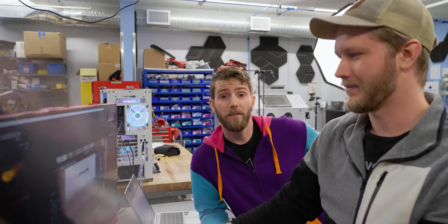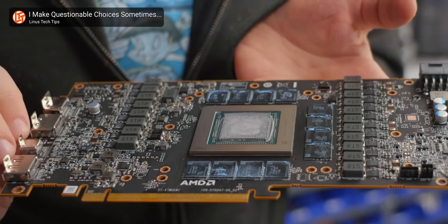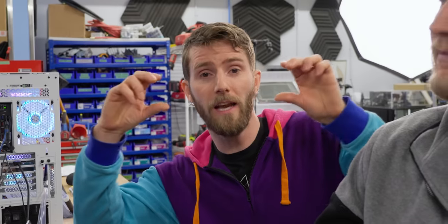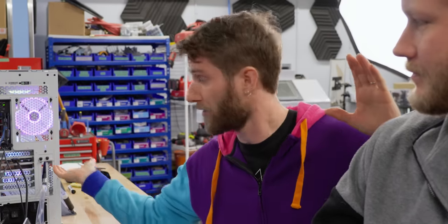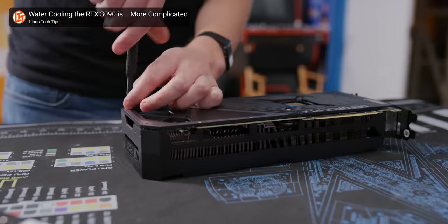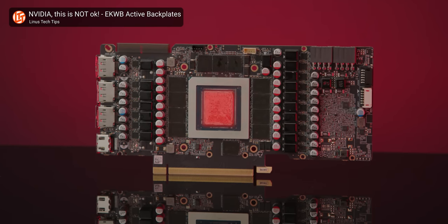Wow. Fun fact, pretty much all GPUs have no IHS, so they are direct die cooled right out of the box. That's for a couple of reasons. One is that an IHS adds Z height, which would make your graphics card thicker, which is undesirable, or at least it was until recently. Number two, they're not meant to be user serviceable, so there's very little risk of anyone accidentally cracking their die. And three, because of size and space constraints, they want to get the best possible cooling out of these things, so going directly to the die gives them the best shot at that. They also tend to be larger, so having just two heat pipes on it and them drying out is less of a concern. They're a little less power dense.